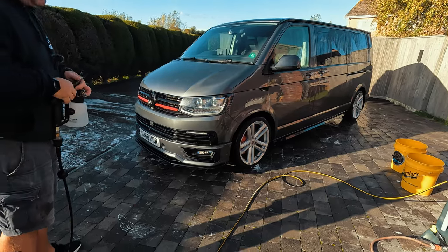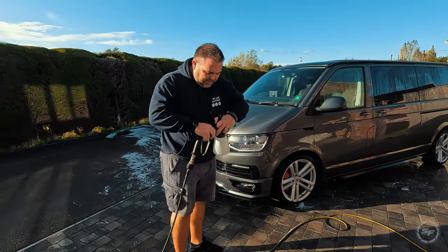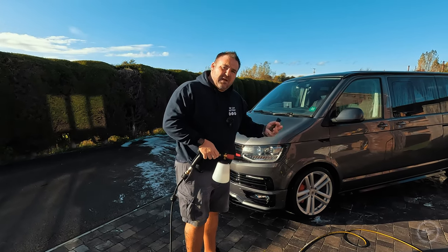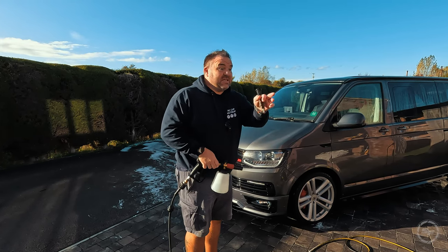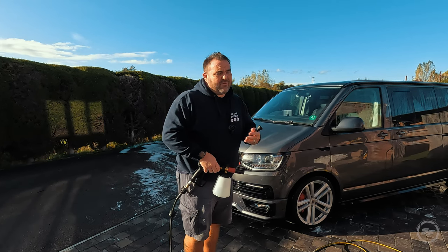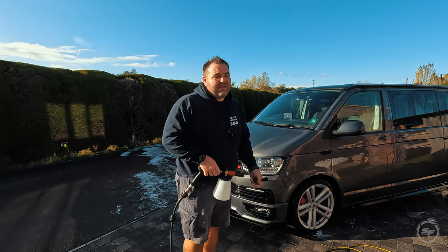Right, so change of tack. We mentioned earlier, with the weather the way it is, we wanted to do a full chemical decon, dry it, go through all the processes, all the stages, and then we were going to use one of the sealants I brought from the selection on the table, apply one of those, and give us in the region of 6 to 9 months. This product we're going to put on now is about 3 months of protection.